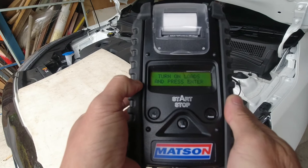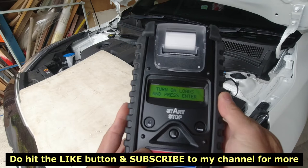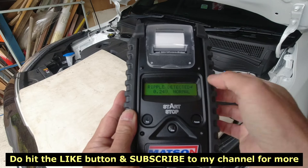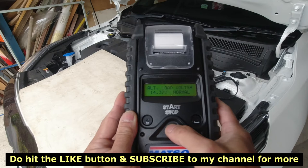So I'm just going to pause here and turn on all loads, including lights and air conditioning. I have now turned on all the headlights, high beam, air conditioning, internal lights, and the fan as per the instructions, and press enter, and it says it's detected ripple 0.24 volts, but that's normal, that's good. Alternator load volts 14.37 volts is normal, and the test is over.